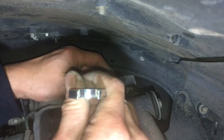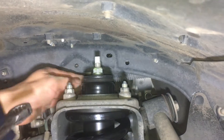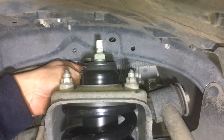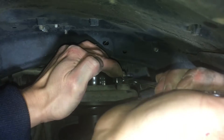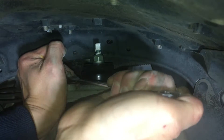If you're wondering what tools — it's a 14mm, usually. You never know who's worked on the car, we've had them other sizes as well, but usually they're 14mm. A ratchet spanner is ideally what you want. Once you do the front two — the easy two — rather than try and ratchet spanner, you get your finger around there and tighten it up by hand — bang, just get those nice and tight like that. Beautiful, that's about 30 Newton metres.